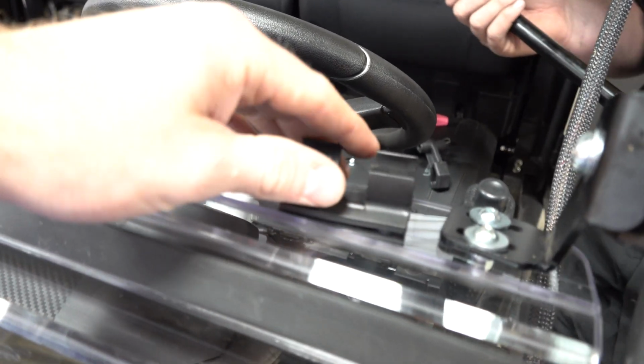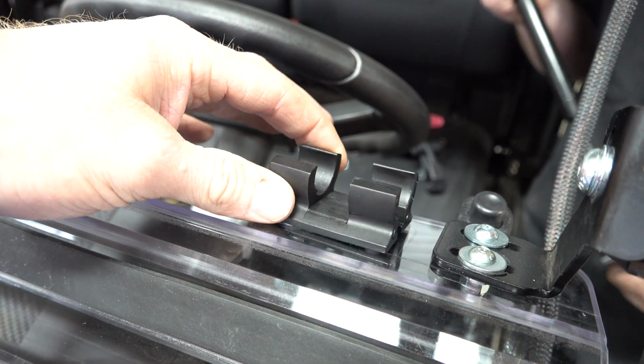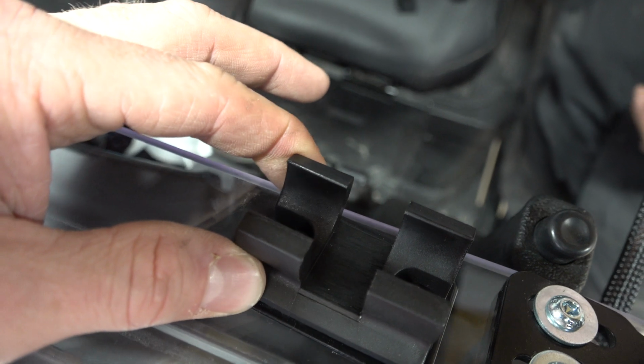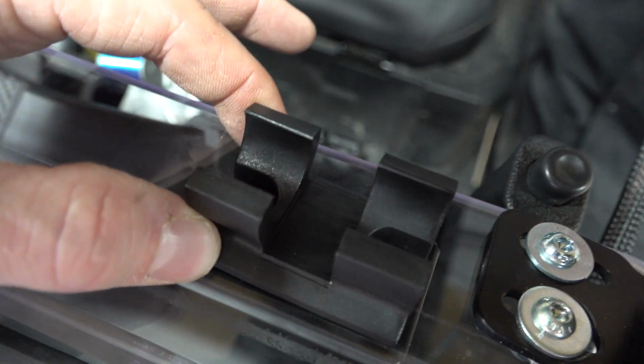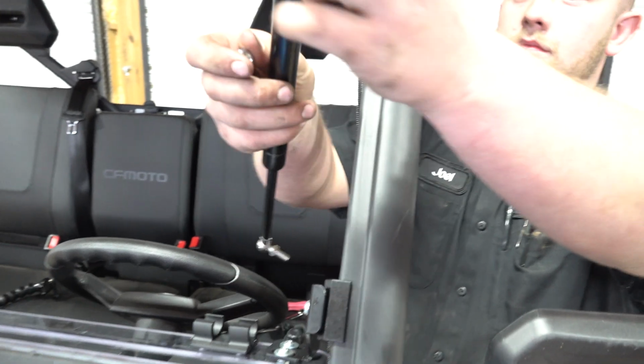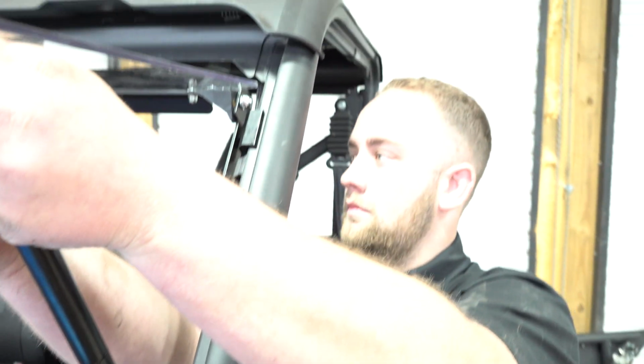What you want to do is take this mounting bracket. You see we've left it loose, and you've got to put these Allen head bolts, which are 4 millimeter Allen head bolts, right there. Put them through, and then on the bottom side you are going to have a little metal brace bar that comes in the kit. It's all labeled, and you use those nuts there, put them in, don't tighten them down yet. And now Joel's going to just go ahead and put the support strut in.